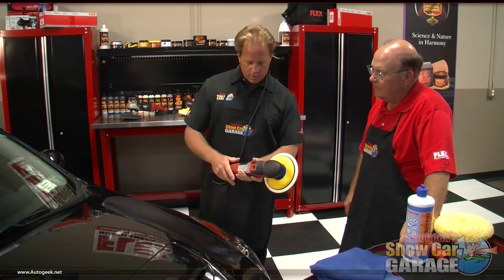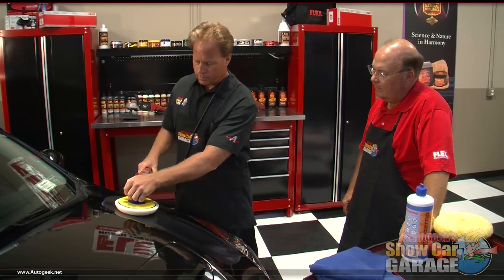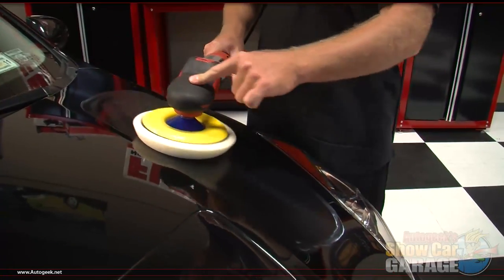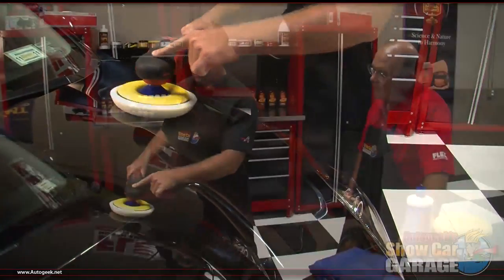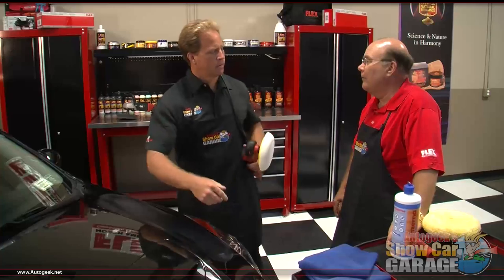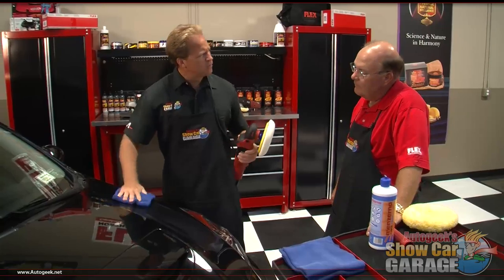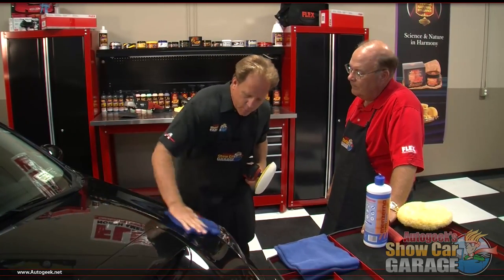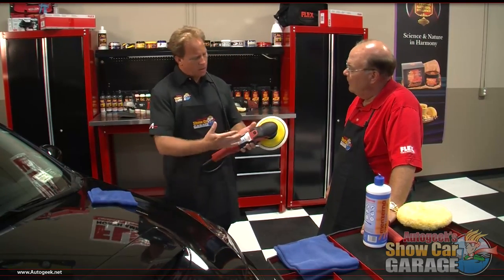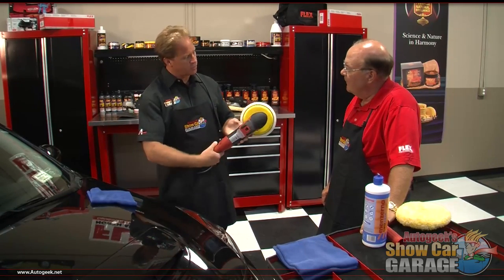While my product's still wet, I'm going to bump this down to the 1 setting, which is 600 RPM, and try it without the handle. Oh, that is nice. This unit is designed to operate at slow RPM. We teach a class here on how to wet sand, cut, and buff using a rotary buffer, and what I teach people is that learning to master the rotary buffer is first learning to control it. The compact size and ease of use means this is going to be very easy for even someone new to rotary buffers to learn how to master.